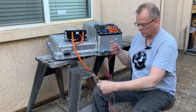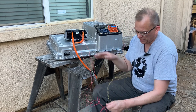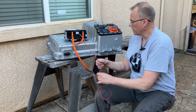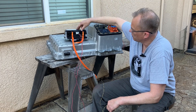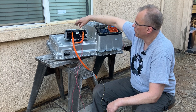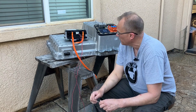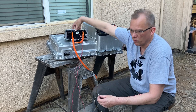The two reds will be our positive. I will probably use a bench power supply — for something like this I like to put in like a 1A fuse; if it blows I'll put in a 2A fuse, and if that blows I'll go to maybe a 5A. Super scientific, but it has worked for me. So we have power and we have the CAN — this is the battery side, this is how we will connect to this box. For this test we don't need a battery pack here. We could use a single module or we could just simulate a battery by connecting to the inputs with another bench power supply. And even without any high voltage connected to it, the contactors will click when we manipulate them, when we control them with the zombie.